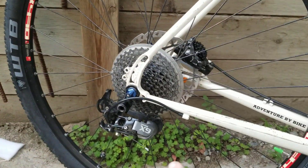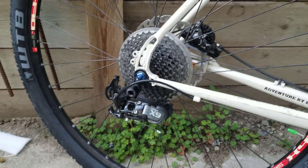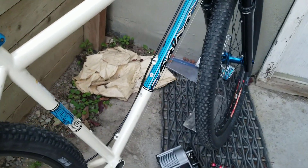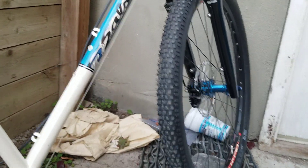At the back it's a 10-speed SRAM X9. I've put on some different tyres — the widest I could get with these 29×2 inch tyres. Pretty tight clearance but I wanted the width. I went with a 2.25 inch on the front because you can get away with a bit wider with the fork.